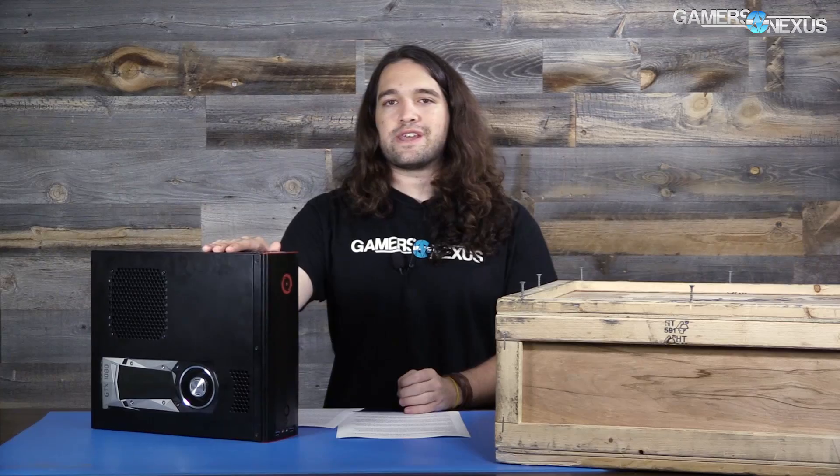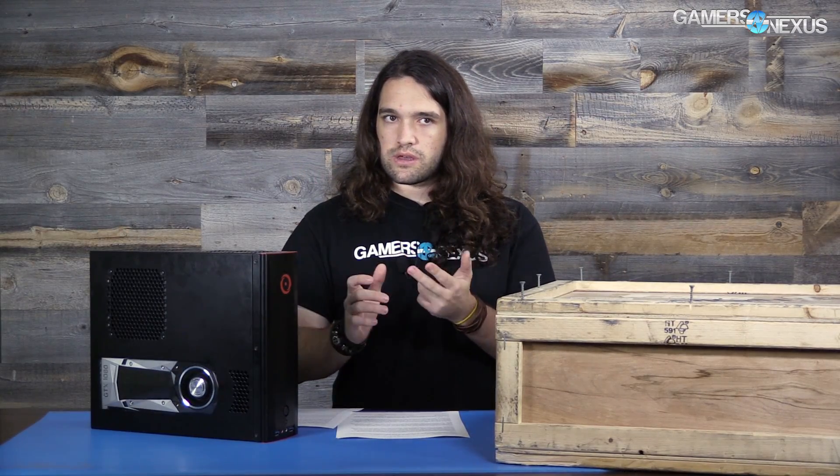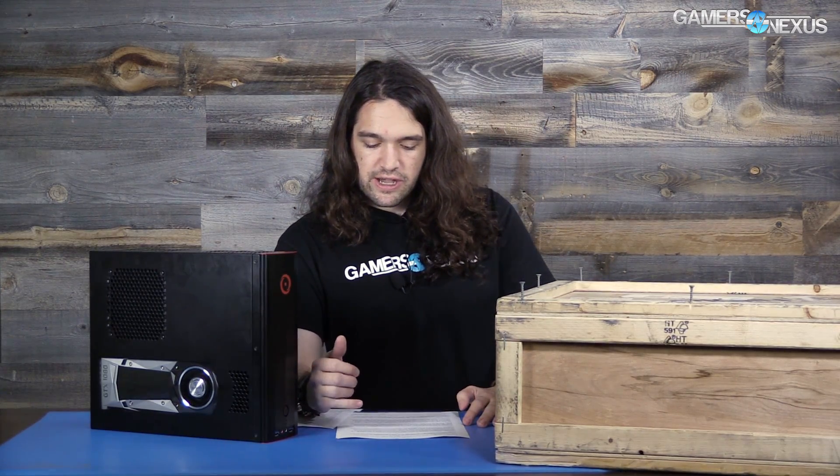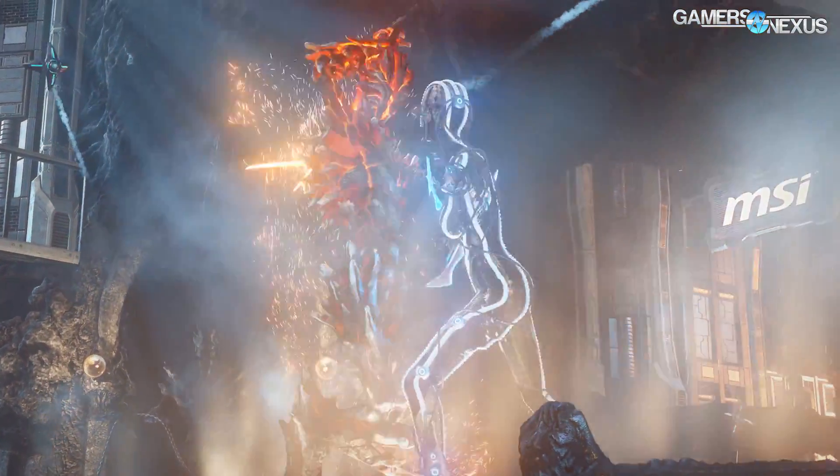The system has a 450-watt SFX PSU from Corsair — actually a good power supply. It does sound crazy to put a 450W PSU with a flagship 1080, but that's where the world is now with TDP. NVIDIA recommends a 500-watt supply, but that's a conservative recommendation unless you're running a simultaneous 100% GPU transcode and 100% CPU workload, which is not a realistic use case. When we tested, I saw a power draw of 282.9 watts for full system power running 3DMark Firestrike Ultra at 4K looping using the combined test. That's fully within acceptable range — a bit over 50% draw — and this power supply is not going to be threatened.